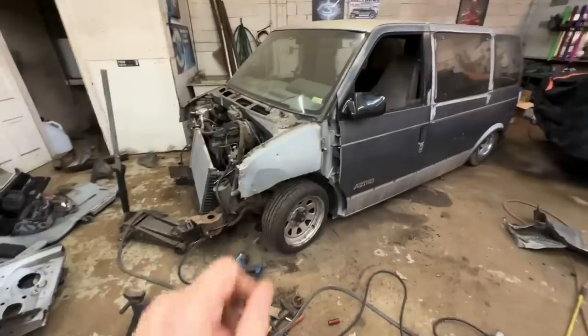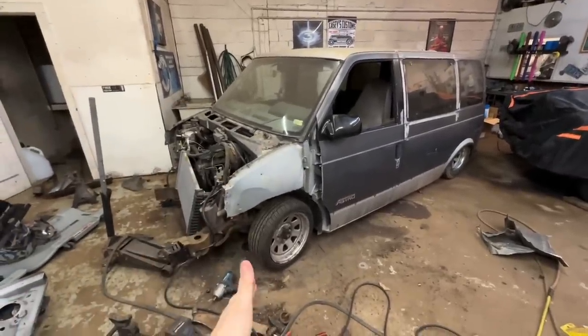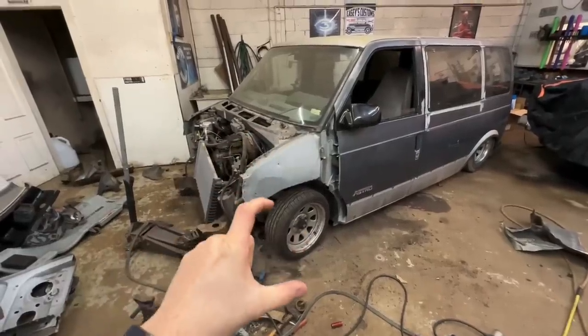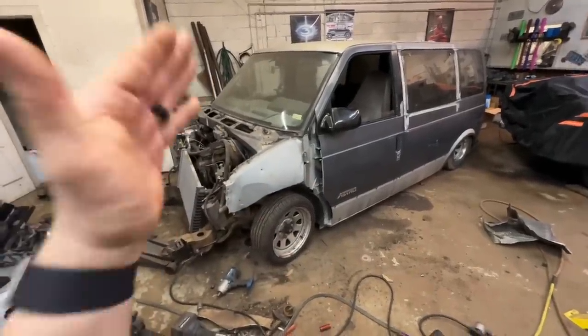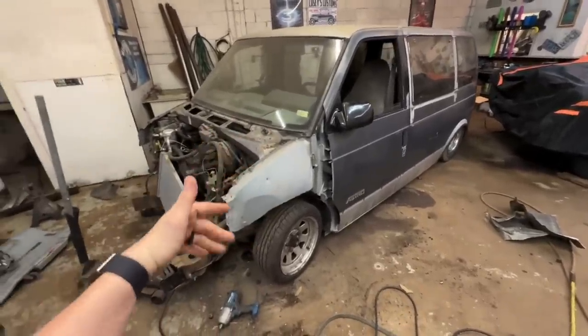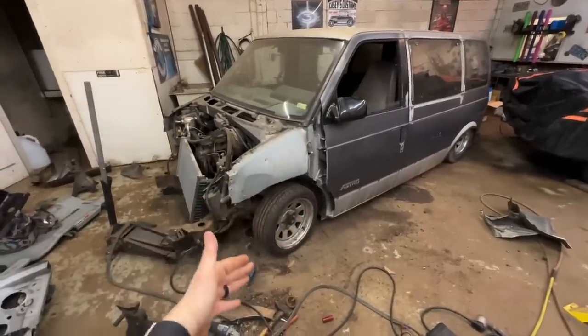The next day. We are back. Today is the final day we have to work on this baby, so we're going to hit it really hard. We need to get it jacked up, get the bag cups out of there because they're way too tall. I knew that was an issue before. I probably should have started with that, but because we were already running into the inner fenders and we were already having some weird tie rod angle stuff, I knew the spindles needed to go in either way.